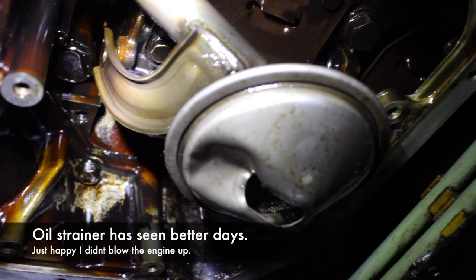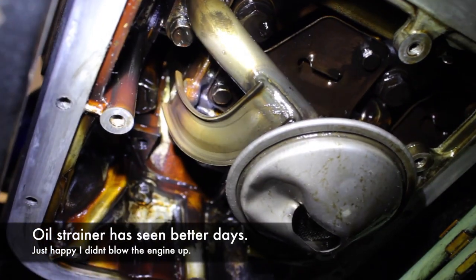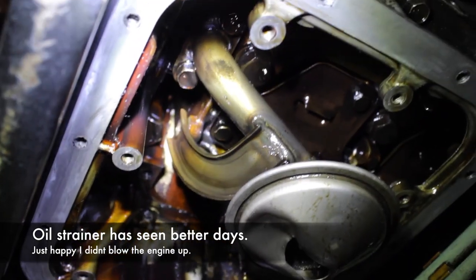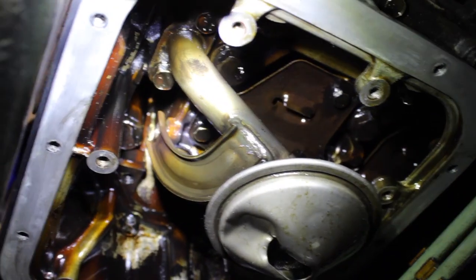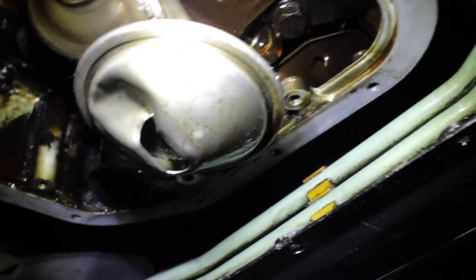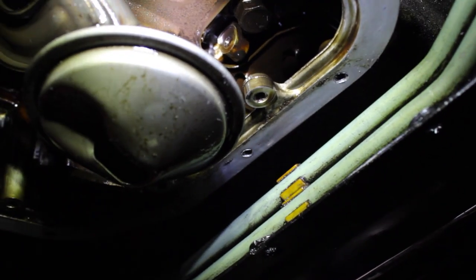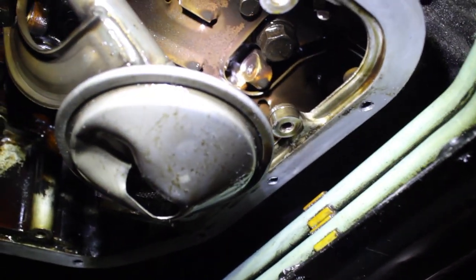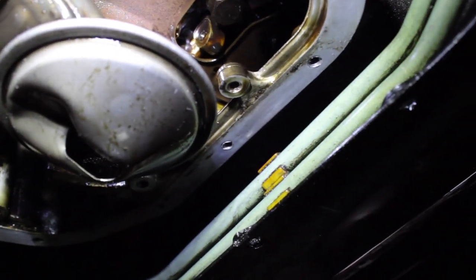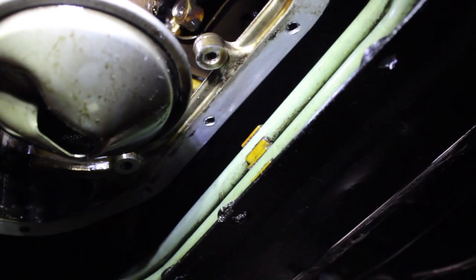So it's not going to be up here. For the older model red top SRs, it's going to be in this configuration. And then if you mod it to the S14, you're still going to have the two that mount up to there, but now your bracket's going to be mounting up to the back. So I can understand why people are saying it's going to be hard to get there, because you got to have really small fingers or a small hand to get in there, because you have to compensate for the bracket swooping into that location, and then you have to thread a bolt in.